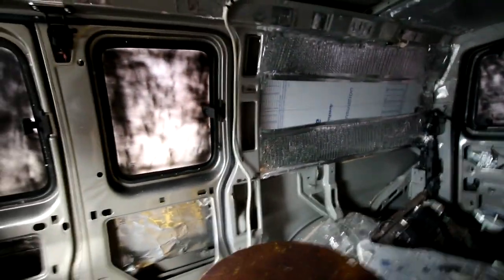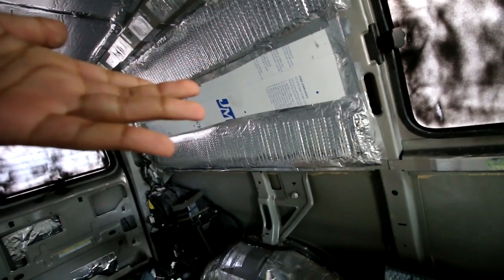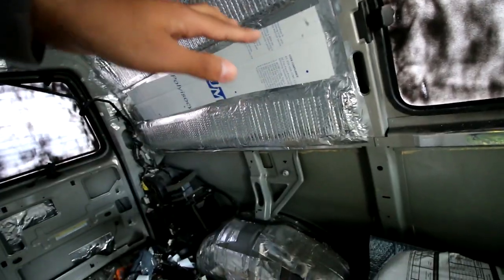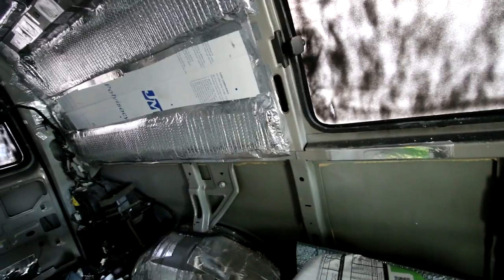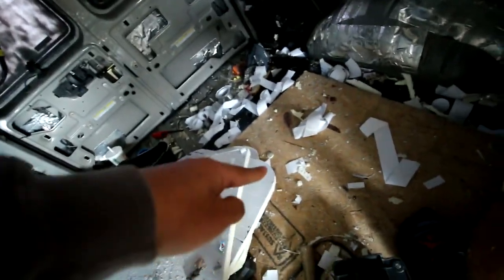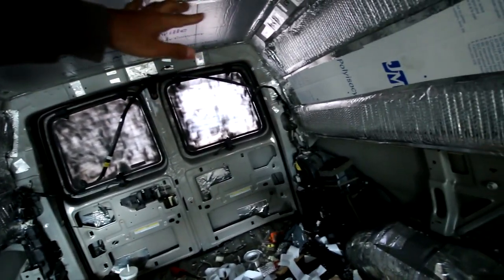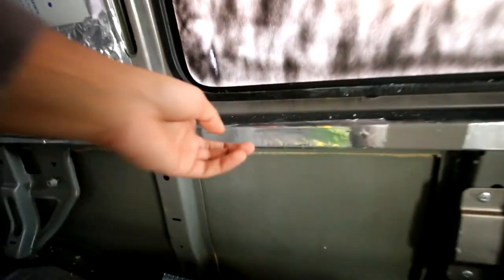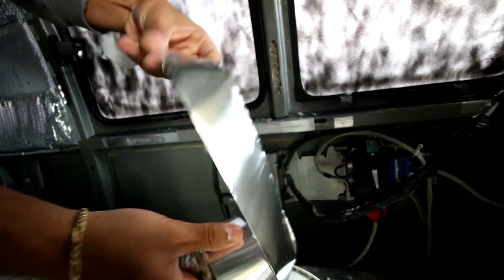This is how the van currently stands. We're gonna do a rundown of the exact steps I took to get here. First thing: strip the van. If it's a cargo van it's gonna be much easier; if it's a passenger van you're gonna have to strip everything — all the panels are most likely gonna be broken off so those can't be sold, but the seats you can sell on Craigslist or throw away. Second step: install a floor with the bottom rail under it — you want a stable floor, so just install a plywood floor. Third step: clean everything — the walls, the windows, everything. Fourth step: patch every hole you see. All I did to patch the holes was add some insulation in there to make it nice and tight.